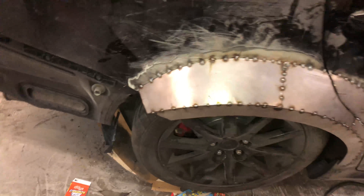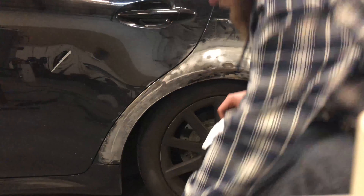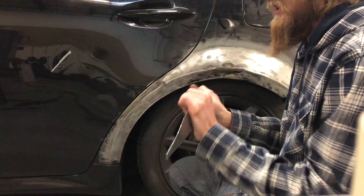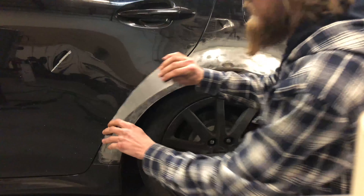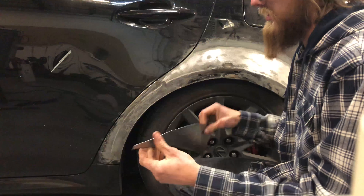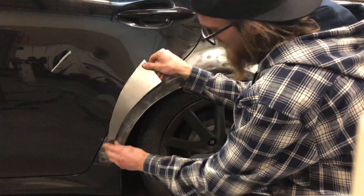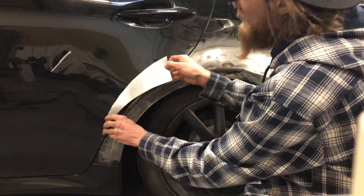There she is welded up for the most part. I need to pick up some seam sealer to do that and tack the hell out of it so she's nice and solid. Now I'm going to show you how I bent those other panels - not doing that tonight though. These are 20 gauge thin sheet metal - you basically just lightly roll and shape them to make sure it all fits perfectly flush. You don't want any big gaps and you don't want to have to bend it into place after it's already on the car. So you test it, bend it, test it, bend it - probably 50 times - and eventually it'll fit perfect.